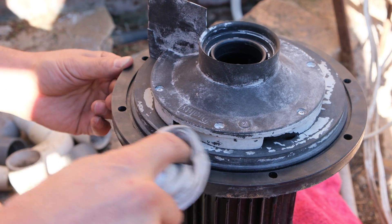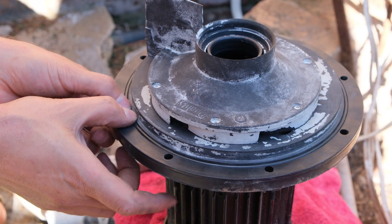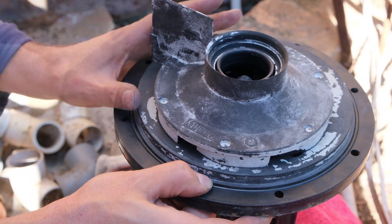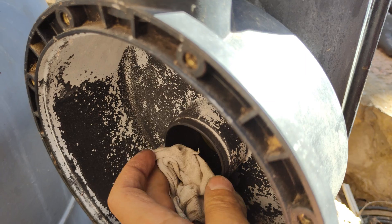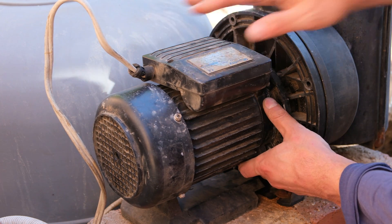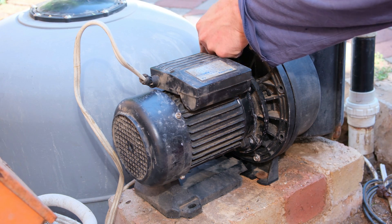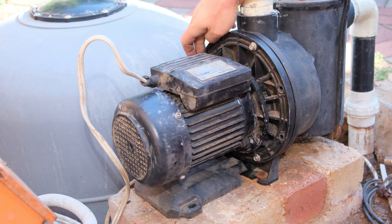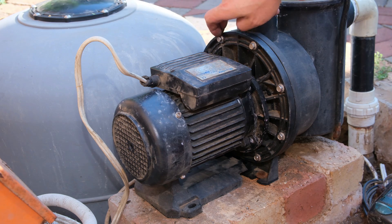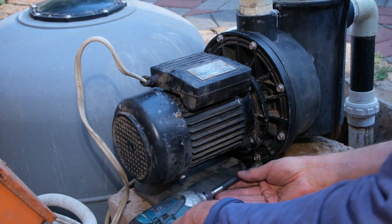The o-ring seats over here, so I'm wiping out the channel to make sure it's completely free of dirt, then seating the new o-ring. Be careful because this o-ring might pop out — keep making sure it's seated properly, especially when reattaching the motor to the housing. I also clean the inside and seat the replacement o-ring there. I screw one in at the bottom and one at the top — just finger tight — then go opposite side, opposite side, and slowly tighten them alternating opposite sides until they are all quite tight.